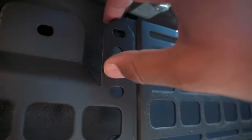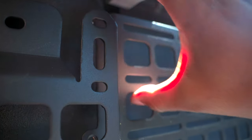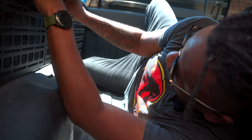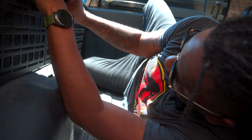Those last three bolts included in the package are for the 5/32 inch allen key. Right in the middle there is where the panels meet together. I'm going to climb into the bed of the truck - it's probably a lot easier without the cover on, but I'm not about to take mine off. Inside the actual panel where you'd normally put a nut and bolt, it's already threaded. I'm going to thread these very loosely and keep the whole panel pretty loose.